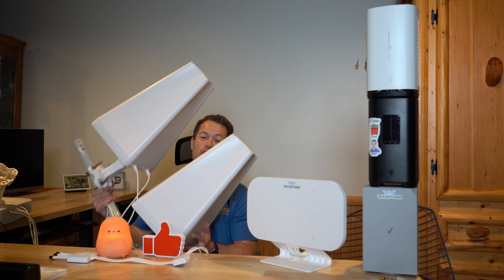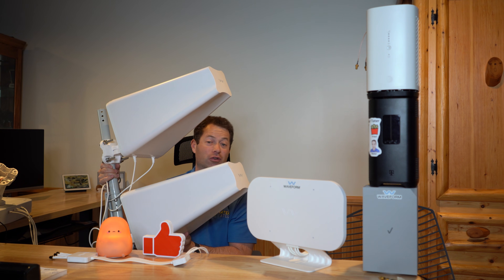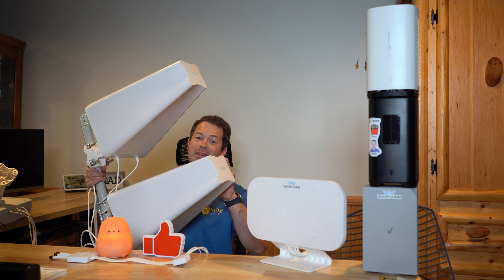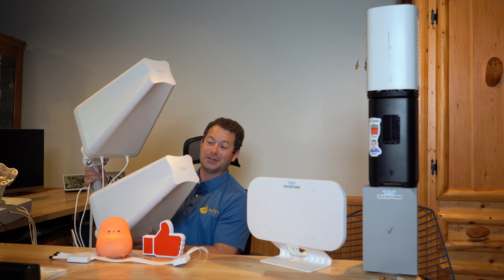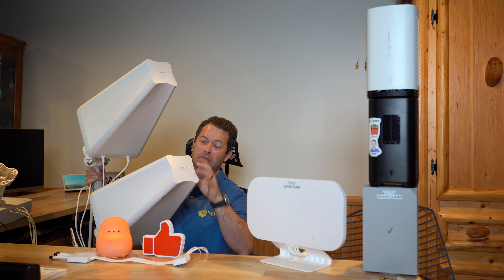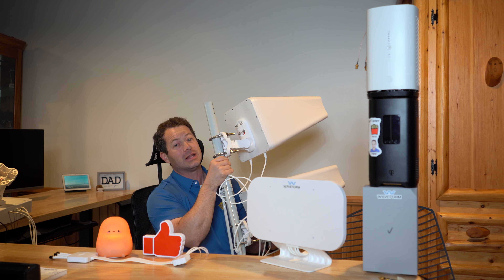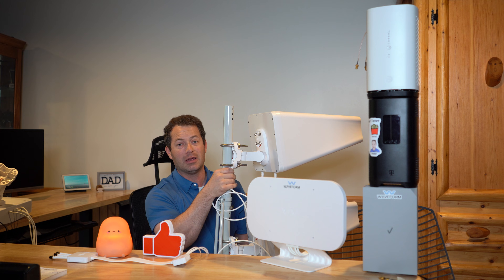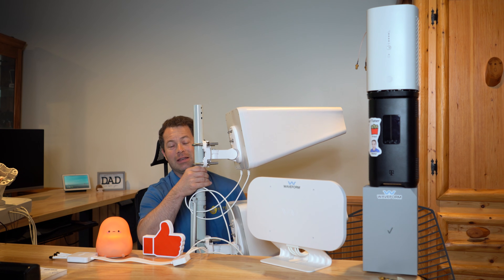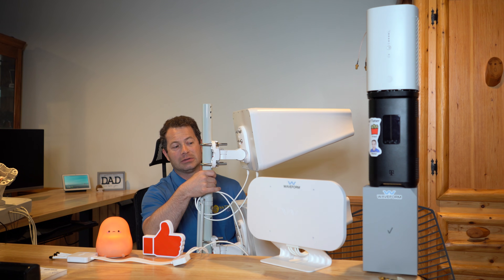Next up we have the Dual Plus Duo. Each of these is a 2x2 MIMO antenna, so you need two of them together to have a 4x4. You can use just one if your gateway only has two antenna ports. What's great about this is that it's more directional than the Quad Pro and it offers higher gain. If you really don't get enough signal even with the Quad Pro, this is an option. These work better with line of sight — maybe a tower eight or ten miles away on a hilltop. But if you're heavily hidden in trees and terrain, the Quad Pro might actually perform just as well, and it's cheaper and easier to install.